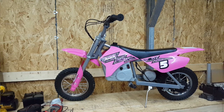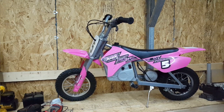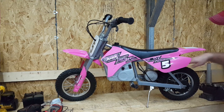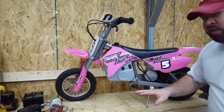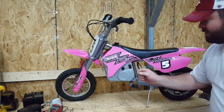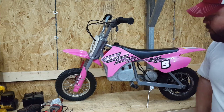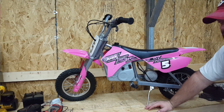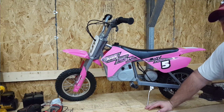Hey guys, I appreciate you watching. The bike is back together. MX350 is back to where it started from. Got the plastic and the seat back on. Also remember there's one Allen head bolt underneath the gas cap, two behind the seat to install the top portion. The battery box has Phillips head bolts with nuts encased into the plastic — there's two across the bottom, two across the front, and a short one on the very top. Again, I appreciate you watching. If this has helped you out, please give me a thumbs up and subscribe to my channel.